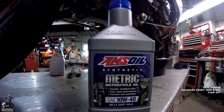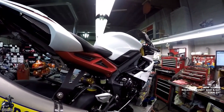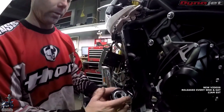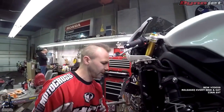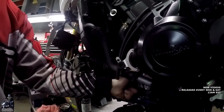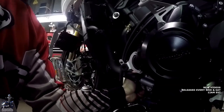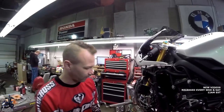Pull the fill plug, let it finish draining out, then snug the oil filter up. Get the engine face clean first. Take a little old engine oil and wipe it to lubricate the filter — I've seen it multiple times in different service manuals. You want to put something on it so it doesn't stick to the engine. Once it touches the face, go a full turn — that's a good rule of thumb for any oil filter, car or motorcycle.